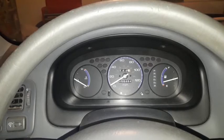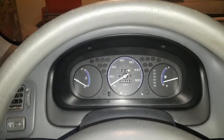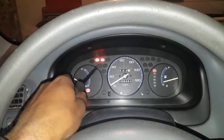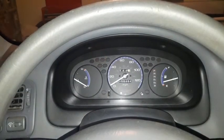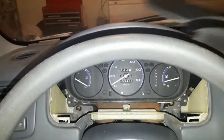What's up boys, Stack 612. Right now I'm working on the 900 Civic — the Canadian Civic. If you haven't seen the earlier videos in the series, there are a few problems with this gauge cluster. The previous owner took out the check engine light, so I put in a new bulb but it still doesn't work. The code that's on is P0135, which means the top O2 sensor is not working properly due to the cracked exhaust manifold. The check engine light still wasn't functional after the bulb replacement, so I decided I'm going to have to replace the instrument cluster. You'll be surprised at what I found on Craigslist.